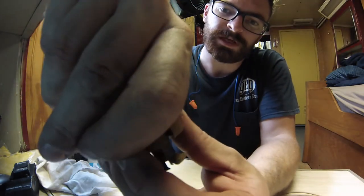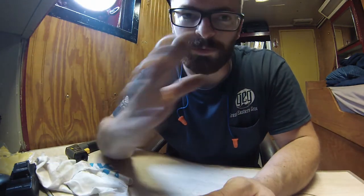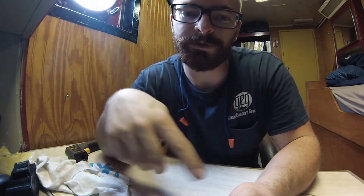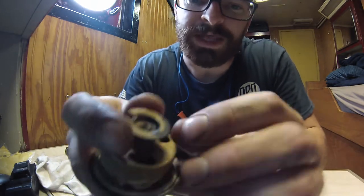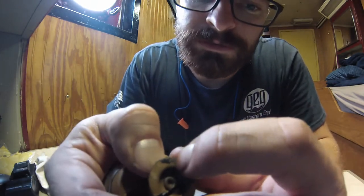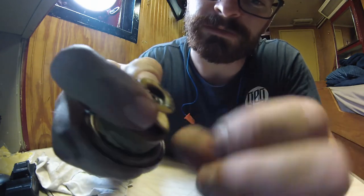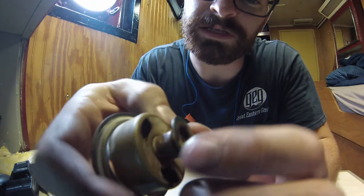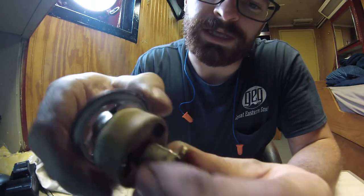When this opens up, it closes one valve and then water comes in through it the other direction. It's like having a Y-pipe — it selects which direction it wants to go, recirculating hot water or sending the hot water to get cooled off. This black stuff that leaked out is the wax — some sort of high-temperature wax. That's the beauty of these things: their simplicity. It all leaked out when I cut into it.